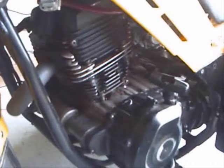After we got the engine out of the frame, got everything disassembled, we cleaned all the parts and sent the cylinder off to Don Rich Race Engines in Exeter, Nebraska. There he bored the cylinder out one millimeter, which is equivalent to 40 over in standard sizes. While we were waiting for the cylinder, we went ahead and did some work on the head — ported and polished the intake and exhaust ports, reshaped the combustion chamber a little bit, mainly getting rid of casting marks and smoothing everything out for better, more even flow. We also installed our custom-made billet camshaft from MegaCycleCams, honeycomb-style valve springs from R&D Springs, and a new cam timing chain.